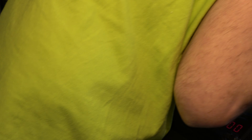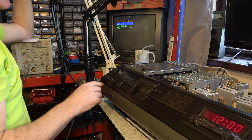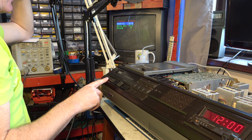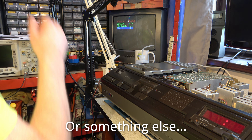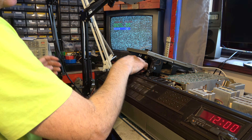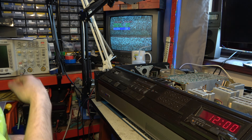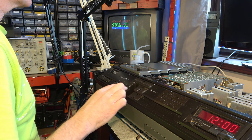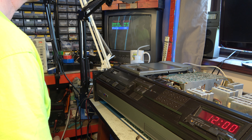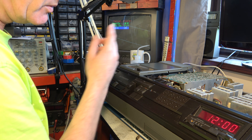This TV is tuned to where it was last used with an N1700 video recorder, but this modulator could be on a slightly different frequency, so it may not match. Right, that's not tuned in. We could try tuning the TV into the video or setting the modulator to match the TV - I think we'll tune the TV. Switching it off to confirm that signal goes away - yes, that's close. Well, that looks like we have no working heads - that's the result you get when the heads are completely worn out.